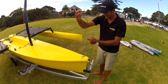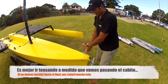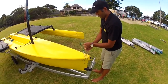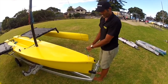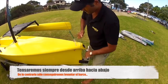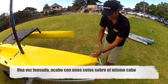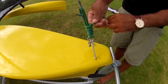I use a few half hitches after going through a few times. An important trick is to tension up as you go — I've seen people lash it all up with no tension, then crank down and it just binds the line, making it really difficult to tension. Gone through twice, then put a bit of tension on. It's always easier to push down rather than pull up — if you pull up it just wants to lift the boat. Go through a couple more times, then finish with a few half hitches to use up the tail.